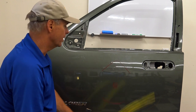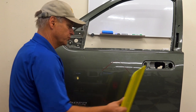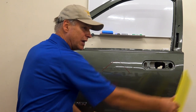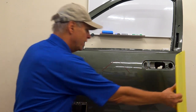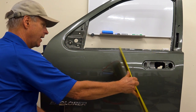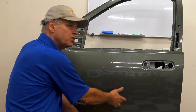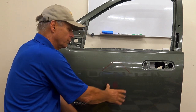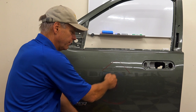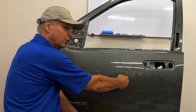Okay, so next thing we'll do, check for any vertical pressure traps. Start again about 6 to 8 inches outside your dent, sometimes even further, and run that board into the dent. And you see a small one right on the edge. And guys, where these love hiding is right on the edge of the soft little low that's left in your dent. So if you have a soft little low from, say, there to there, pay real close attention when you're just entering that low and coming in.